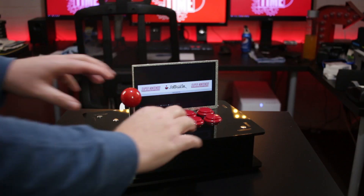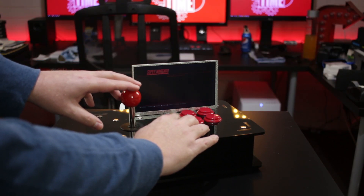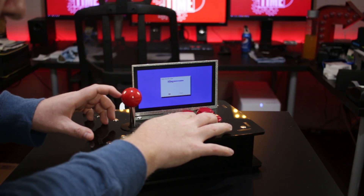After transferring a few ROMs via the RetroPie ROM Manager, it felt really awesome to navigate with the arcade stick and buttons fully configured. But there was another issue — no sound through the speakers. Pressing the side volume buttons produced nothing, so I jumped into the RetroPie configuration screen and changed the audio from Auto to Force 3.5mm headphone jack. Saved the configuration, did a quick reboot, and now we're cooking with gas!